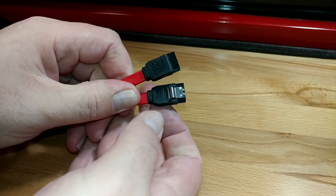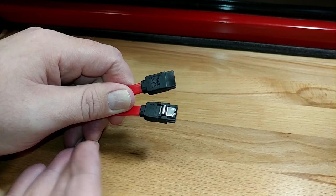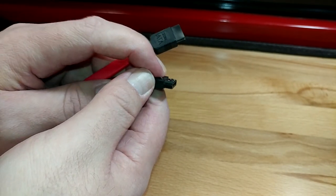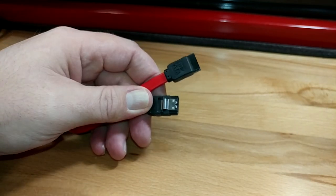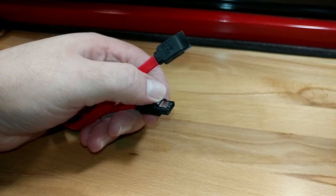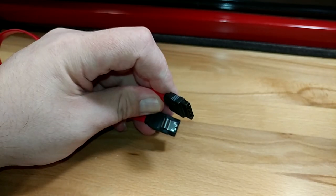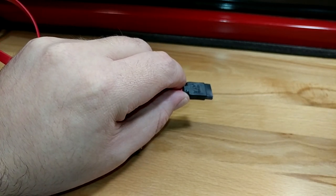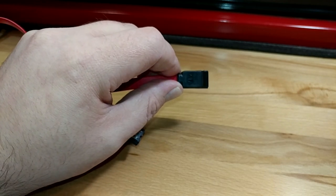The next consideration is do you want one lock or two? You can see this cord just has one lock on it, so to get it out you have to push this locking feature to remove it. In that video I used one of these because on the drive end I felt it would be a nice way to secure it while we fumbled with it so it wouldn't come loose. But on the motherboard end, I had pretty good access to just plug it in — and later on to release it, a lock there could have been a pain, so I didn't particularly want locks on both ends.